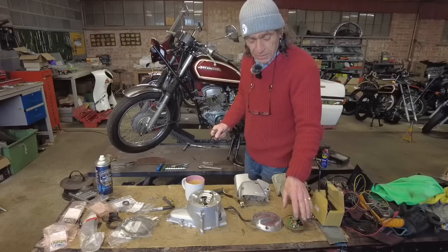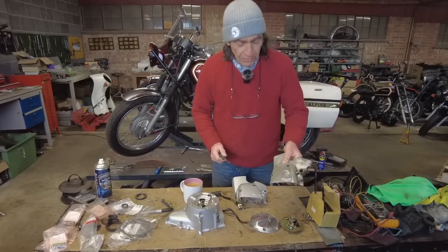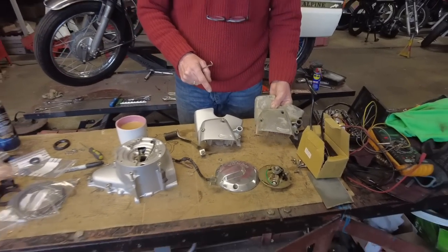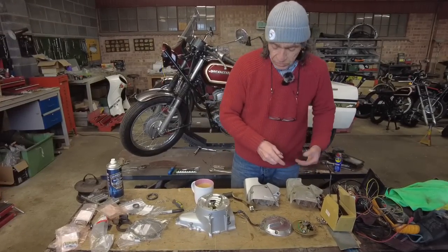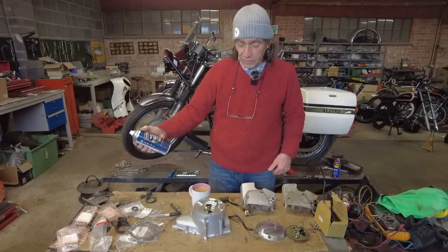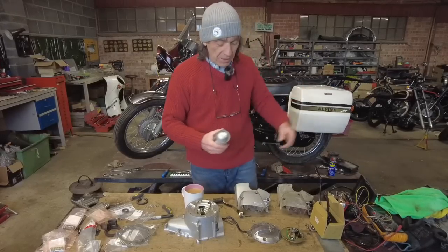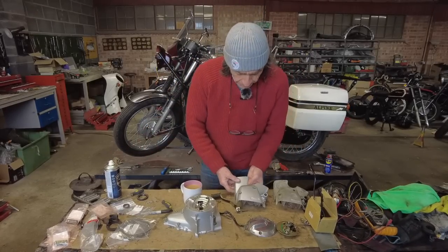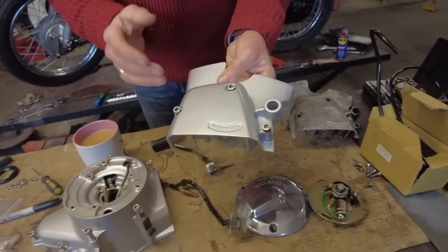This cover goes on first, then you fit all the timing gubbins, put the cover on and away we go. Now you may notice the state of this cover - that's just an old one I had on the shelf to show you. They were very scabby. All I did was rub them down with wet and dry - a slightly coarse grade and then a really fine one - and then puffed it over with a bit of Hammerite smooth silver. I think this is a really good match for Honda engines. I had it on the shelf, gave it three coats, put it in front of the space heater late last night, and it's dry this morning. I'd like to leave it another day but I need it back on the road. I think they look lovely.